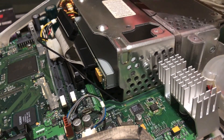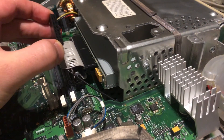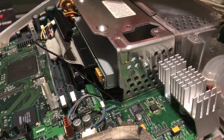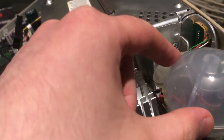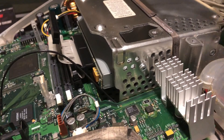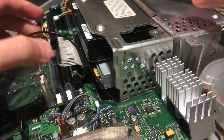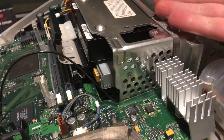Here is a closer view of the hard drive caddy as well as the CD drive. You can upgrade these if you want to, but it is a bit cramped so you would have to find a special drive. You can also install a larger capacity one, or even an SSD, which would help with the cooling as well as the speed. We also have some heat sinks, some high voltage circuitry, and the speakers which are encased in these plastic spheres which help with the sound reproduction. The hard drive itself only goes in one way — it slides in, and there are four screws you do have to tighten. After that you just have to connect the IDE cable, Molex for power, and after that we can then reassemble it.